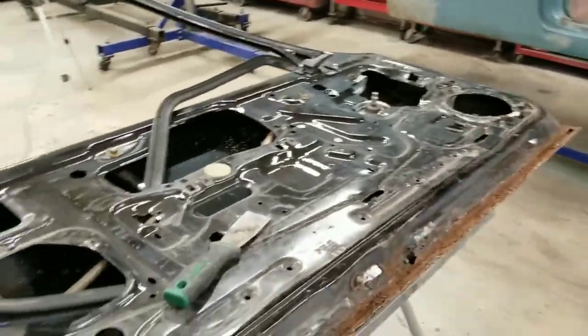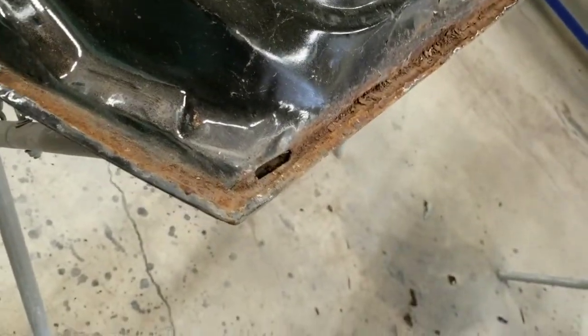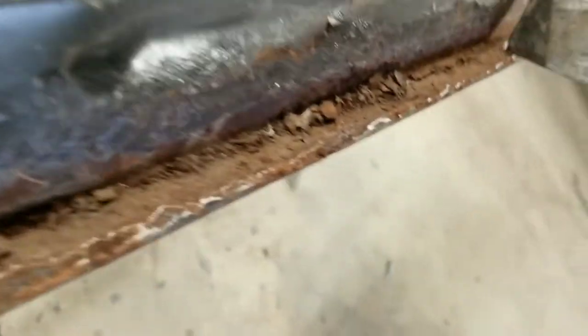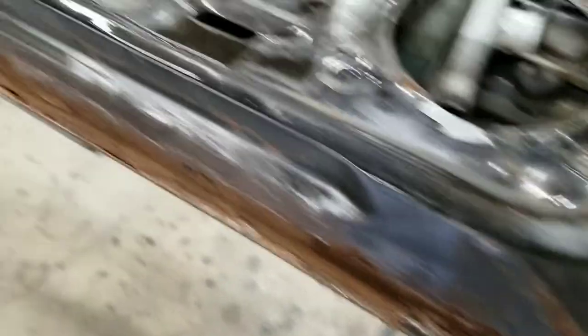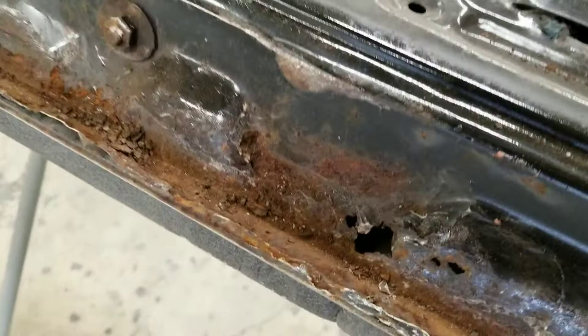All right, here are our doors — you can see they're pretty rough. Somebody had a mountain of bondo on here. I've cleaned up most of it, but this area was completely built up with bondo. There's no lip — the whole bottom lip here is completely gone. Everything looks good from about here up. They actually make a patch panel for this, so we're just going to go that route. You can kind of see a bunch more bondo on the back side of the doors, and I'll have to make a few other little patches that the patch panel doesn't cover.